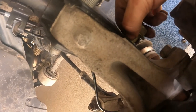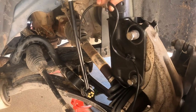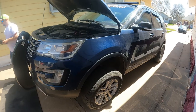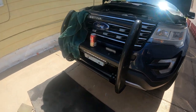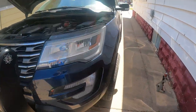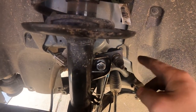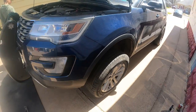Same thing with the bottom bolt — make sure your grooves are in the right spot. Then put this brake line back on up into here, you'll have a little clip right there. Alright guys, we've got everything tightened down, the wheels are on, and we're ready to lower her down. Everything except for our sway bar link is tight — that needs to stay loose because we actually have to do a little bit of driving to let this settle and find its new home. So don't tighten down your sway bar link yet.